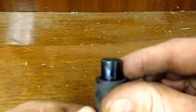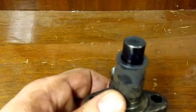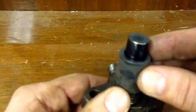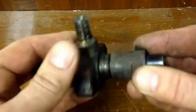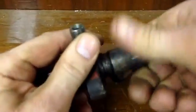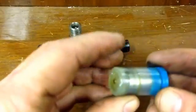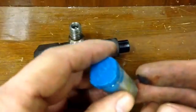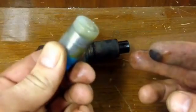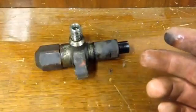This only works for the injectors with a pintle — you see that little thing there, that little dingle that sticks out the top, that's the pintle. There are several injectors that are usually thinner, they go much much thinner like a pen and they're rounded at the tip — it doesn't work for those. So what we're looking at is reconditioning your own injectors.